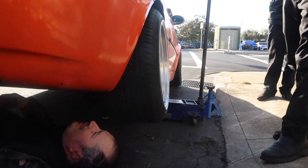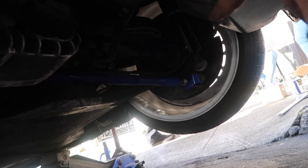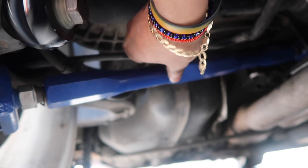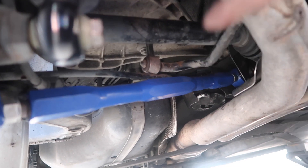True negative on this one, front and rear. Looking at it from the bottom, you can see the control arm right here. These bolts — you have to drop the subframe, the differential and everything to get those bolts out, because they only come out one way and it interferes with the axle and the differential. Something to keep in mind. You can see we have them in. The passenger side is slightly adjusted, there's still some more adjustments to be made, as well as the driver side. You want to leave this a bit loose so you can play around and adjust it without much trouble. Get a large crescent wrench, adjust this, and we'll see how the camber ends up looking once adjusted.